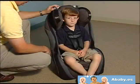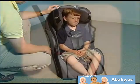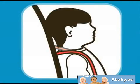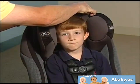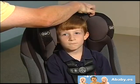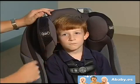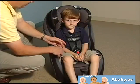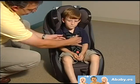It is often easier to adjust the car seat harness before it is installed in a vehicle. For a child riding forward-facing, the harness height must be even with or just above the child's shoulders. If the child's shoulders are above the harness height in the highest position, you will need to use a different child restraint. When the harness is secure, the chest clip must be on the child's chest at about armpit level.